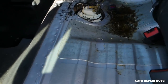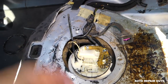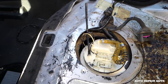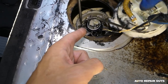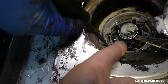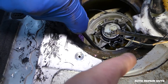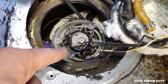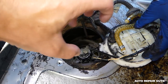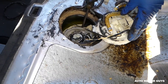Unfortunately we ran into a big problem. There is a special tool that Audi makes for removing the fuel pump, and we'll show you why. Underneath, there are three teeth — you can see them here, here, and here. There is a specialty tool that releases those teeth, and you need to turn it counterclockwise and it will pop out. We don't want to break anything, so we'll go ahead and order that tool.